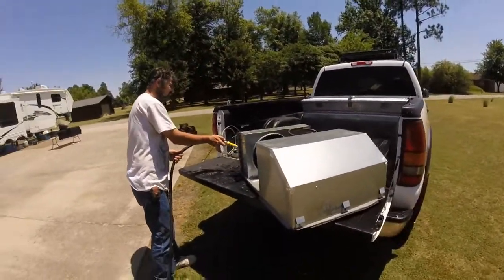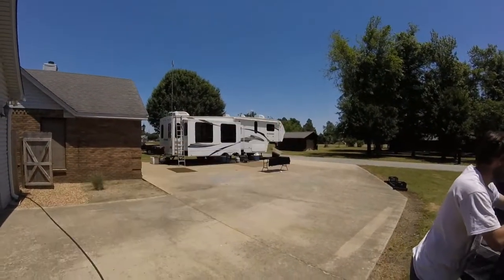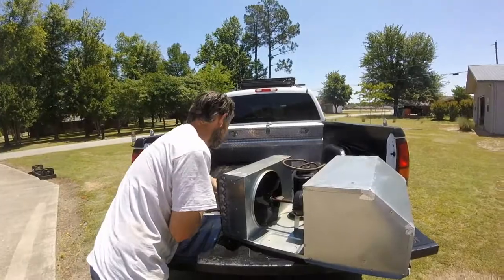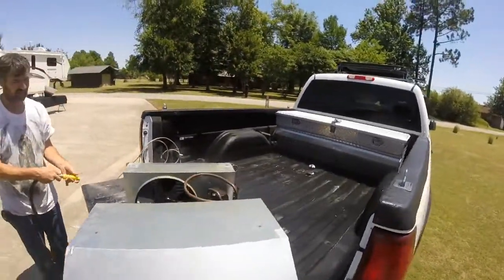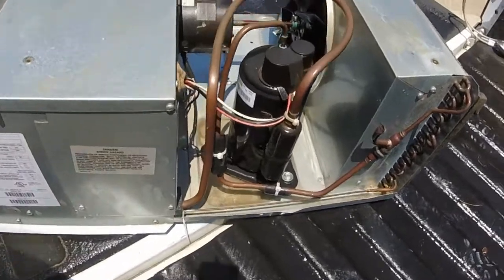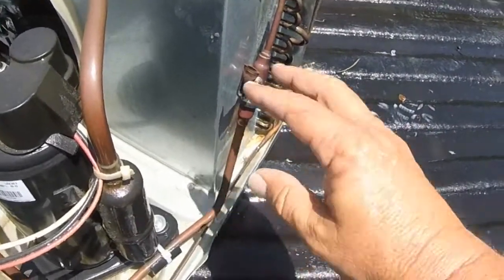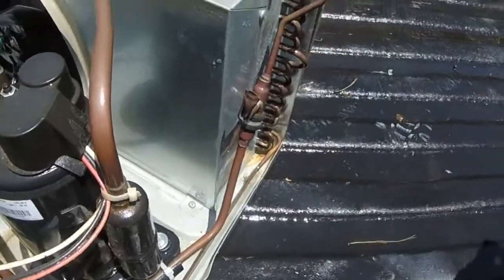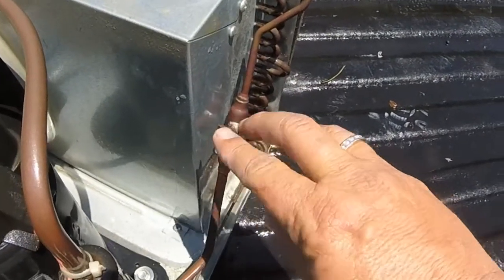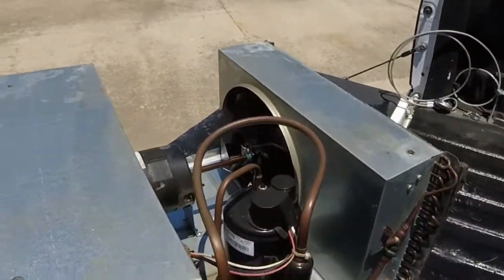If you want to know something that's really upsetting — we've got the new air conditioner up front on top, and here's the old one. I knew it blew a line because all the Freon came out. But come to find out, I searched the line and could not find a hole anywhere. Right here — see this? This is where the manufacturer actually fills and charges the line when they pull a vacuum. All they did was pinch it off, snap it off, and take their line off, and they did not solder this shut. You can see it opened up like a little mouth. All I had to do was pinch that, solder it, put on a little saddle valve, and recharge this thing, and I would have had an air conditioner.